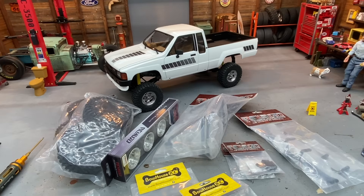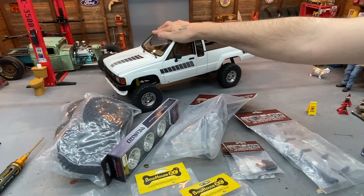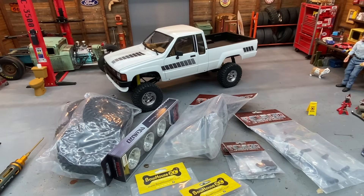This one sits up a little high for the size of the tires. The springs are softer and they come out of the box with a little different setup now. Honestly, it really wouldn't take much to get it to sit lower — mainly just breaking in the leaf springs. But we're not going to do that. We're going to do a show truck kind of build. Growing up in the 90s, this is the stuff we used to see back in the late 80s and early 90s. I've got some really cool parts, mostly cosmetic but also some actual performance parts.